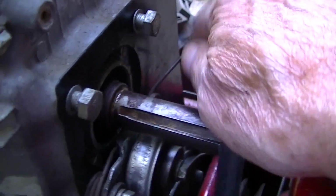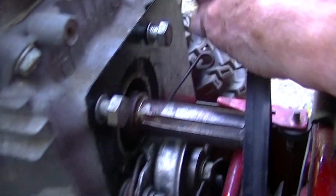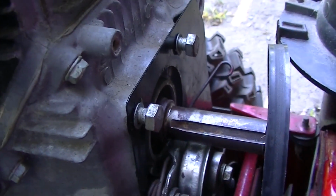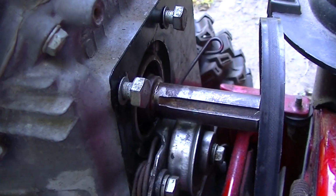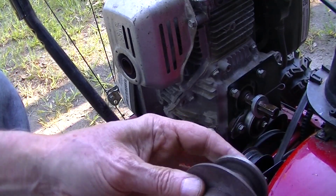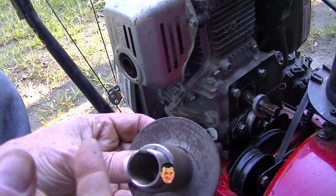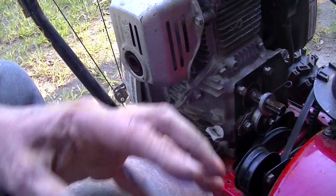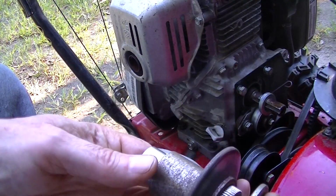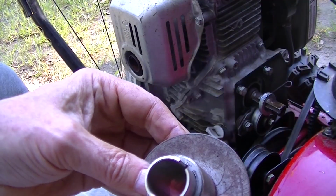I still don't like how this thing is just wankered out here. And it's on the top. I think it's supposed to be on the top, but that doesn't give us room for washers. I don't think. Maybe. Let me try them. I just realized something. It's like game over. The key doesn't hang low enough, deep enough to hit the crankshaft, so this thing will just spin. Yeah, you can just barely feel it, or it'll shear. Fuck.